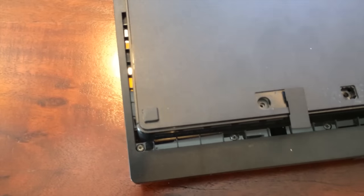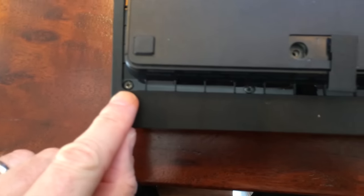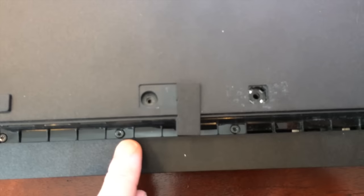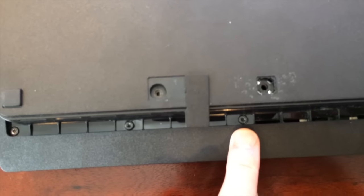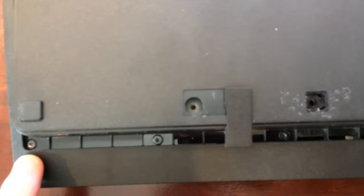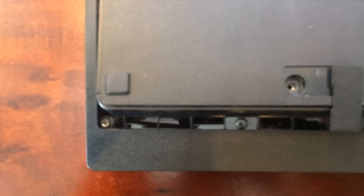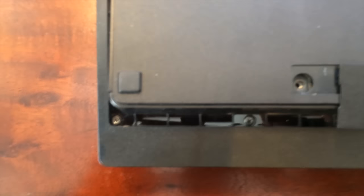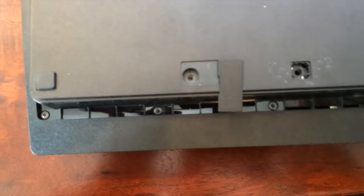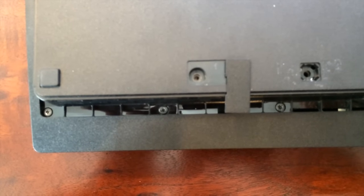Just one left — we've taken all those ones out with the Phillips screwdriver. This one here is a really small Phillips and I just use a jeweler's screwdriver, stick it in there, and out it comes. Now the only thing left is we've still got three more screws, and those ones are those little star screws — I think they're safety ones. They have a little pin in the middle that sticks up, but if you just have the little star tool, it seems to work perfectly fine.